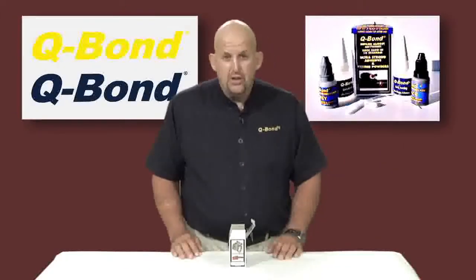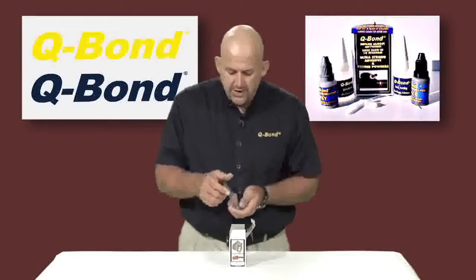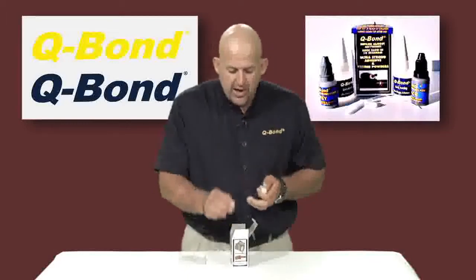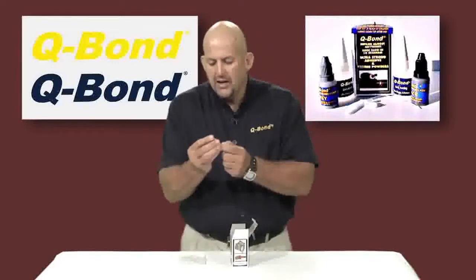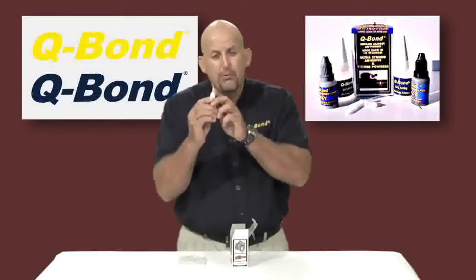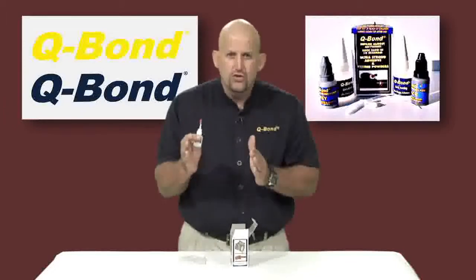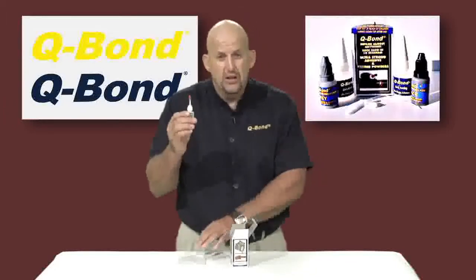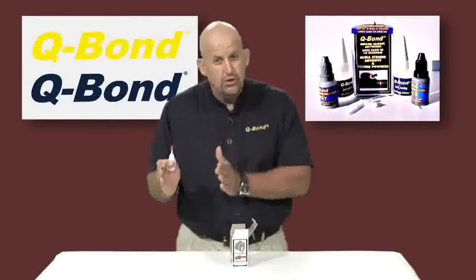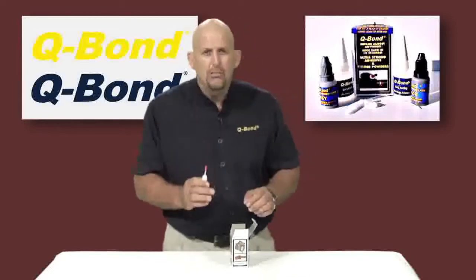Once you receive the Q-Bond kit, it's important to take out one of these pins, and when you've got the bottle, open the bottle and put the pin inside the bottle. You open and close it with this pin. This pin will prevent your bottle in future from clogging up, which means that for the next 2 years, you'll be able to use this bottle for many repairs. Not only the initial repair that you bought the Q-Bond kit for, but many repairs afterwards. It will still be effective.